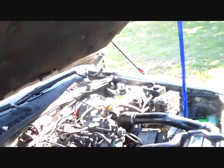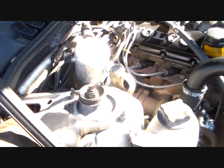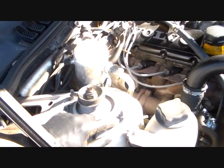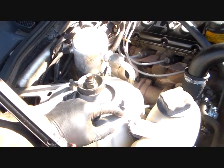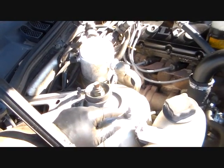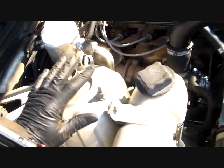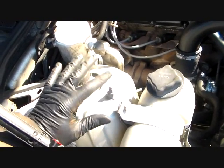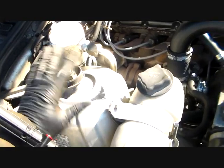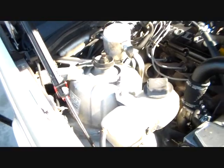You remember when I told you on the Mazda strut video, I said, don't ever touch that. Don't ever touch it. That's true. Don't take this loose. You take these 2 off to get the strut out of the body of the car. Take a Sharpie, make a circle around these or a scratch mark or something so you know how to put these back exactly where they are, because you may or may not throw the alignment off if you take them out. I have never had these out and you don't mark them. I never had them out, so we'll find out. So take those out. Do not take that out right now. Alright, let me charge this battery.